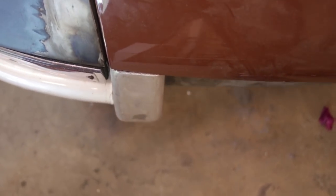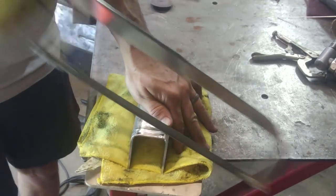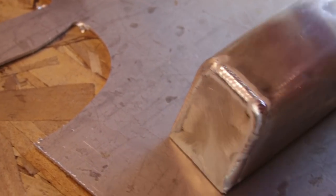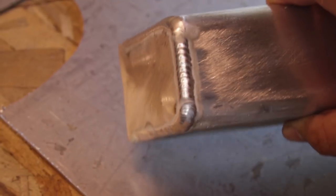Here's a quick view from the top. This portion follows the shape of the deck lid, and then this portion down here sort of follows the shape of this. There is a twist in this part - even though it's subtle, it is there. I'm kind of happy with the way it turned out. I like the overall fit and I like the size of it. I was able to get the cap welded on all the way around on the top, and welding was a little easier because I wasn't having to manage the gaps the whole time.